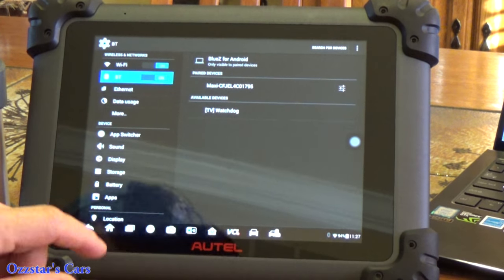With the updates done — I changed my wallpaper — now we need to update the VCI so it works properly. Go to your main menu, scroll over to VCI Manager. VCI stands for Vehicle Communication Interface. It says 'Disconnected' here, so I have the USB cable hooked up — the cable goes into the bottom of the J-Box and the standard USB goes into the scan tool. The USB port is up at the top of the tablet. Let's go to Update — it says not connected.